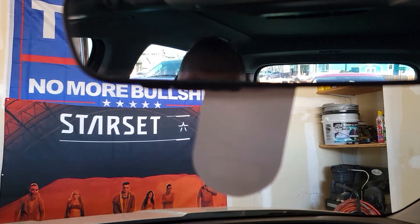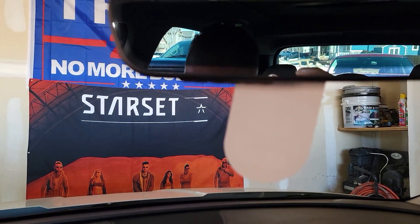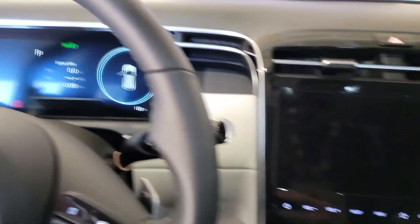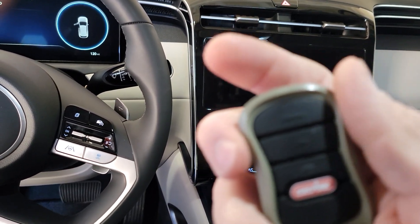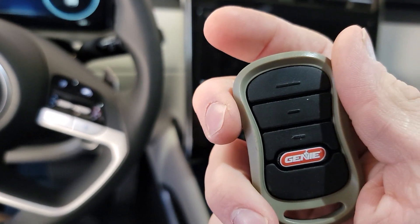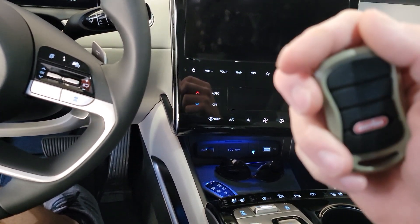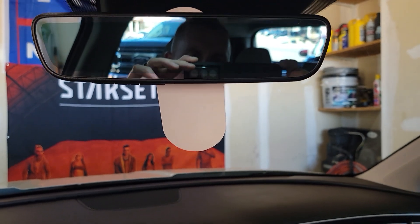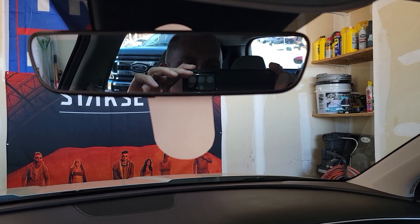And there it goes — you're all done with your HomeLink setup. This process is the same whether the buttons are on the mirror, visor, or overhead console, and it works regardless of the age or manufacturer of your garage door opener. Once you're done, shut off your ignition and you can remove your original remote and put it somewhere safe as a spare. One tip: if the remote isn't reading well from further down the street, check that you're not hanging something on the mirror blocking the signal. Thanks guys — hit that notification bell, subscribe, and come back for the next one!